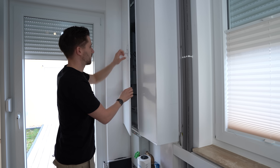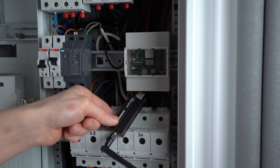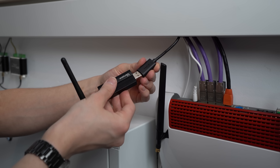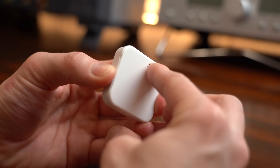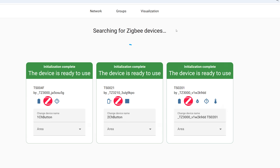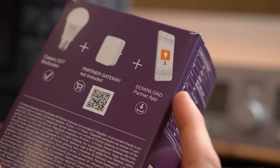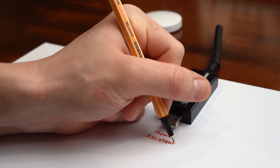The only small problem for me was that my Raspberry Pi running Home Assistant is mounted inside my big distribution box, and mounting the dongle in there would not work. So instead I got a USB extension cable that I ran through my distribution box to connect my Pi to the dongle, which I positioned next to my router. Home Assistant immediately recognized it, and by following the pairing instructions and utilizing the Zigbee integration I was able to easily connect the gadgets to my system. They all work perfectly fine and I can control them all through Home Assistant. A big advantage is that even though some devices claimed they need a partner app, they all connected directly to my Zigbee dongle, so this whole wireless system is basically managed locally.